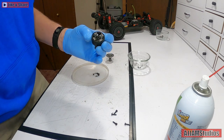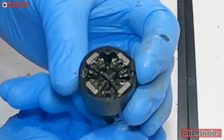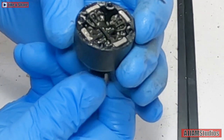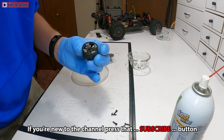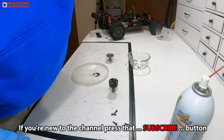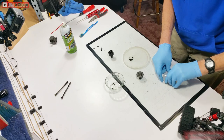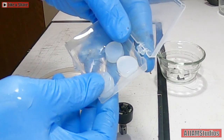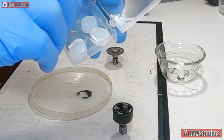That should be just about right. I don't want to get all the oil out, but I want to get a good amount out because I want that oil's lubrication - you can see it still working in there. There's still a little bit of oil down in there. Let's take just a little bit more out. Because this is the rear differential, I want it locked up pretty good. Let's grab an earplug here - these are just flexible, moldable, regular silicone earplugs and these work really well.